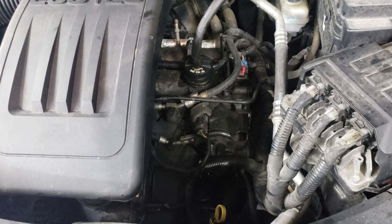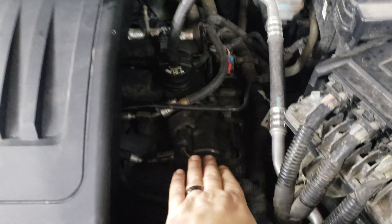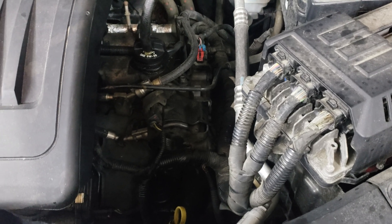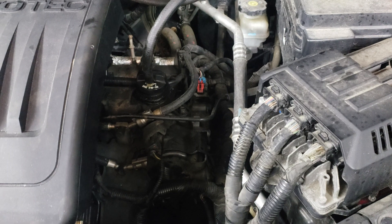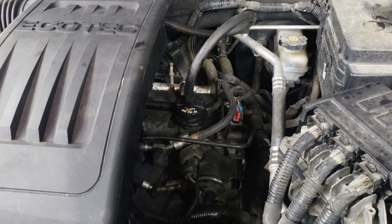It sounds a lot better - the engine cover is off so you are hearing the direct injection pump which is under this little metal bracket. But we don't hear any lifters ticking, we don't hear any knocking or pinging, so we should be good. We'll keep you posted and see how things turn out. Tools are put away, time to clean up and go back to real life. If you like what you saw today, be sure to like, comment, subscribe, and hit the notification bell. Give me some feedback and comments, and until next time - later.